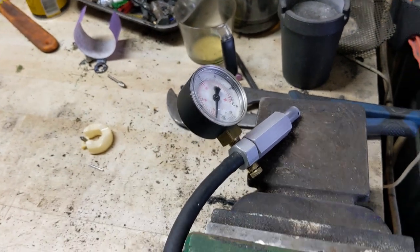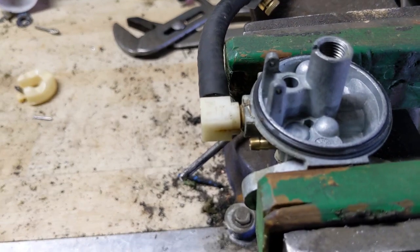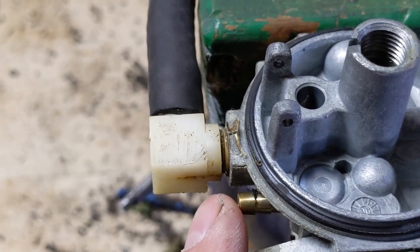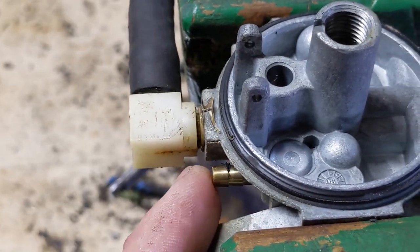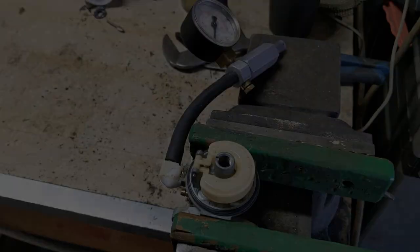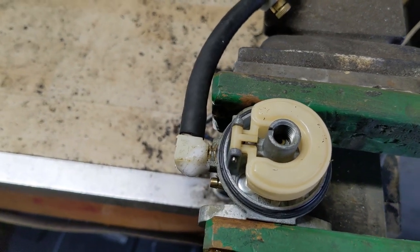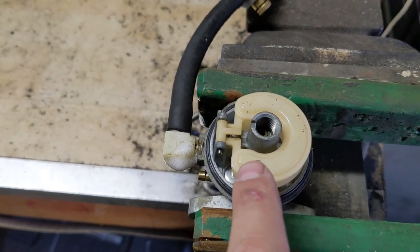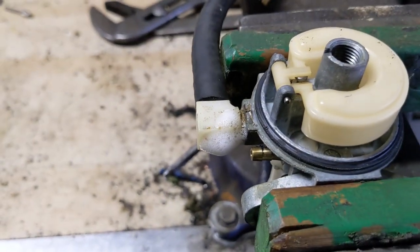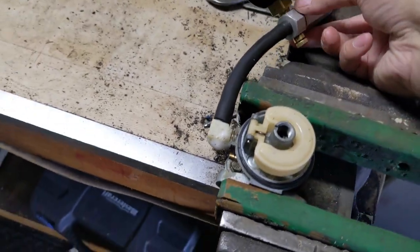You'll see the gauge go up when you pump it, and as soon as you let it go, it will fall back down because you're going to have air escaping from a crack like we do on this particular carburetor, or a leak around the circular seal it makes to the brass insert. If you have fat chubby fingers and can't fit a finger in there, you can install your needle valve and your float. What I have here for demonstration purposes is a little bit of soap on the 90-degree inlet right there.